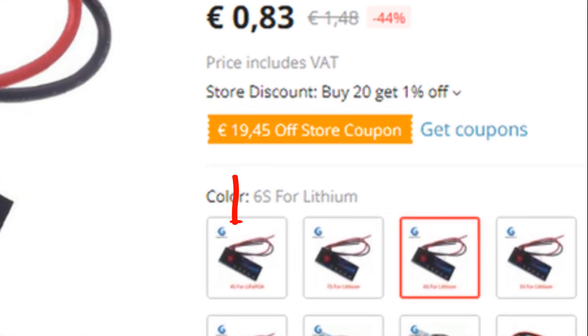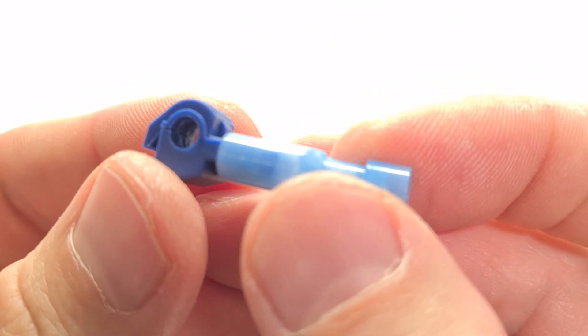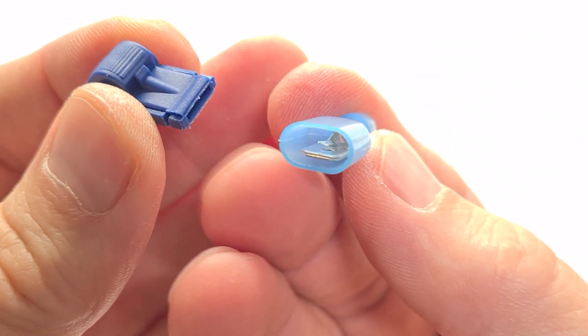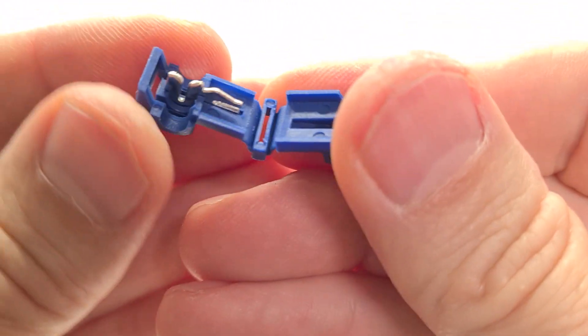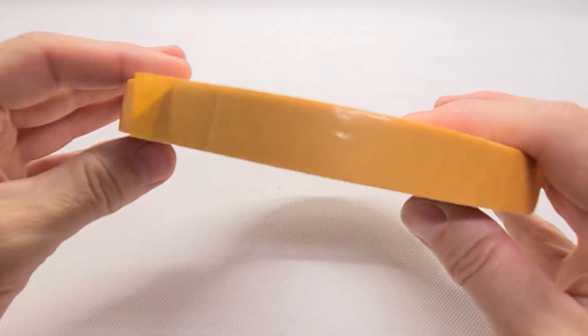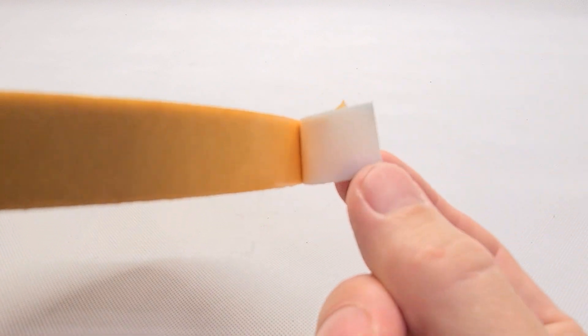What is important is to choose the version that matches our Infanto battery — we need the version for 6S Lithium. Additionally, we need some T-shaped crimp terminals, like these ones I bought on AliExpress in a set of 50 pieces. They are very handy as they allow us to branch off cables without needing to cut or solder anything. Finally, we need some double-sided foam tape to hold the indicator panel in place — only about 3–4 cm.